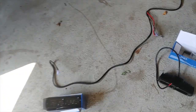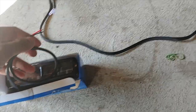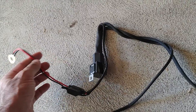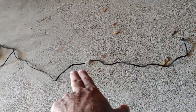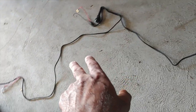Note that you have to buy the LEDs as a separate pair and the wiring harness separately. Each of these LEDs has two termination points — red goes to red, black goes to black. The wiring goes back and ends up with a relay, which is powered by a direct connection to the battery with a fuse in series. There is also a jumper in between and then the switch. The switch portion will be inside the cabin, and from there the wiring goes from inside the cabin out to the engine bay, near the battery, with cables routed toward the LED lights.